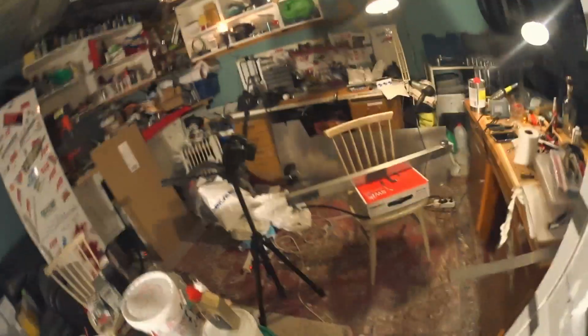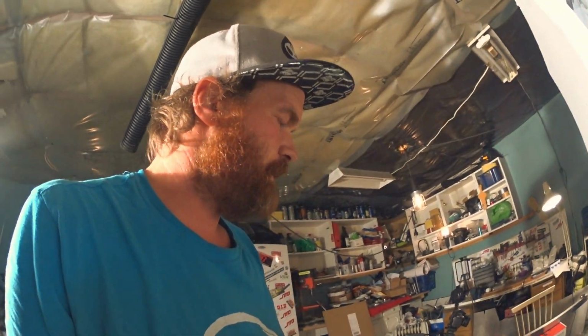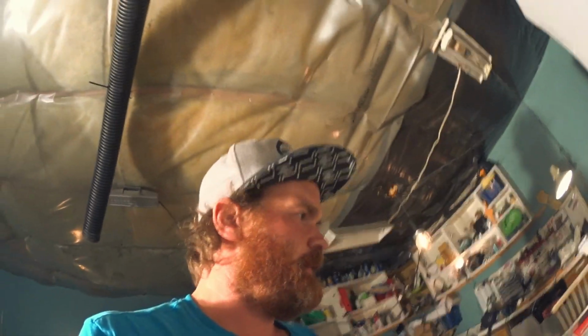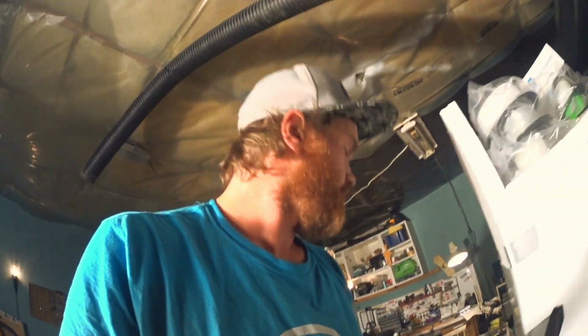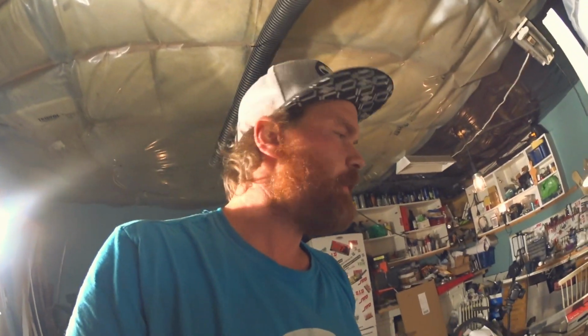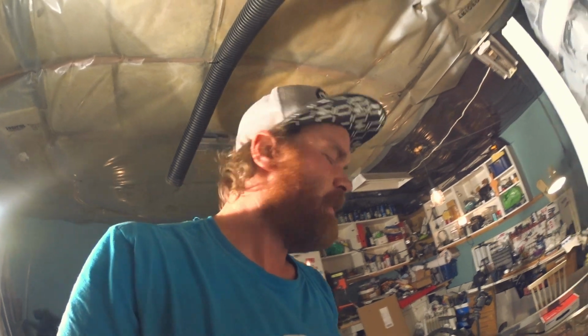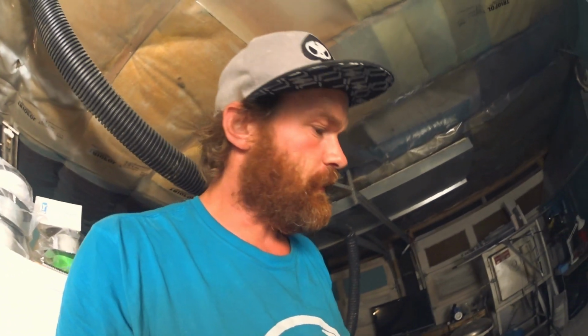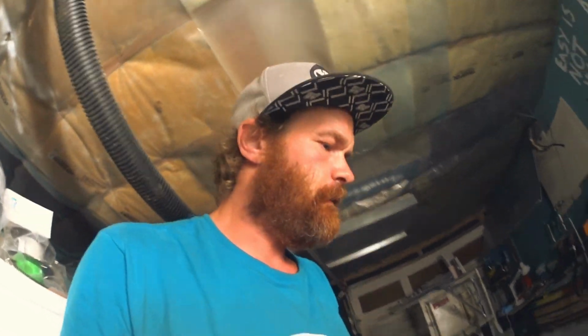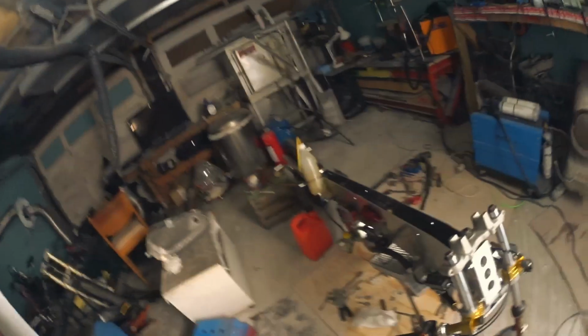The tank has some pinholes. We have welded it for a second time, but still some pinholes. So I have epoxied all the suspect areas, and I think I've plugged the pores, so to speak. So hopefully that'll work, or else otherwise I'll fill it up with some tank sealer. So no biggie.